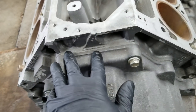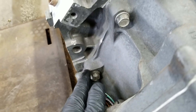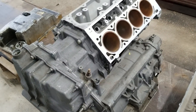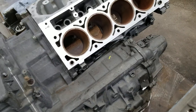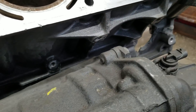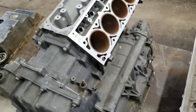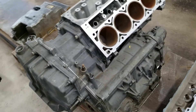So the whole backside of the motor does kind of free-float. For bell housing bolts you end up with your top two and then three and four down here where there is also an additional dowel. That's worked for me, but I'm on solid motor mounts. If you did this swap with poly or rubber mounts I could see it being an issue if the transmission was able to walk independent of the motor. One way you could solve that is by making some type of brace from the diff cover to the engine block — there are mounting provisions there that I would definitely recommend. But I'm not running one and it's worked well for me so far.